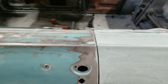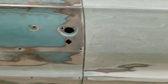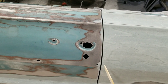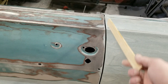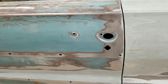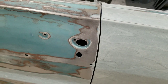I'm going to use some wax and grease remover and clean the inside. I've already taped the inside so no filler goes through. Make sure you do that, get your door exactly where you want it, and then we'll fill this gap completely full with the same fiberglass filler. Let it get about three-quarters of the way dry, then run a razor blade through it right up next to the door as tight as we can, keeping the knife edge flat on that side edge. Do it in sections so your filler doesn't harden up with the door stuck closed.